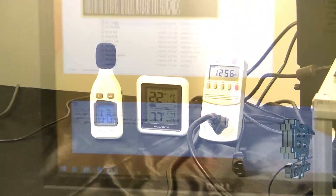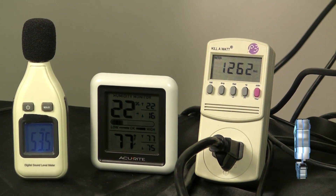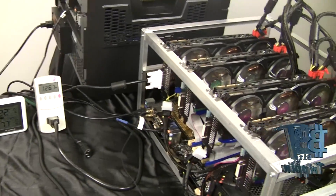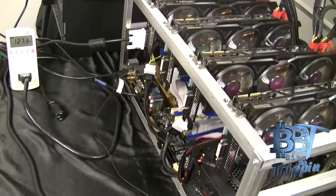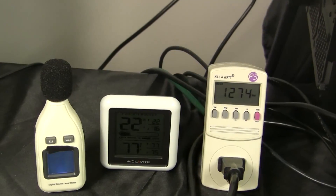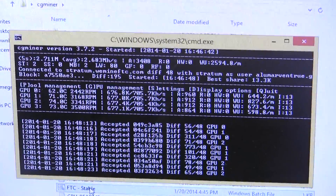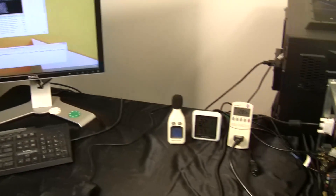Panning back to look at the kilowatt meter, the rig started to stabilize right around 1,265 watts — about 65 watts over the recommended use of this power supply. We played with a ton of settings to maintain four cards on that 1,200-watt PSU, and really it comes down to not exceeding the power supply by more than 100 watts. At 1060 core it shut down within five minutes — 1,365 watts was about as much as it could handle. Bringing that core down is absolutely vital. You'll take a hit on hash rate, but it will pay off when it comes to your power supply stability.